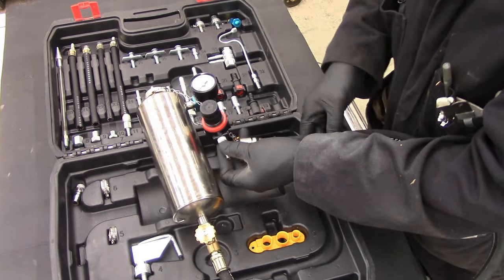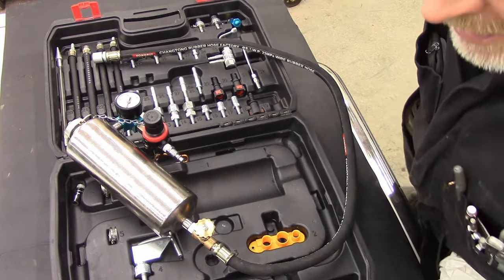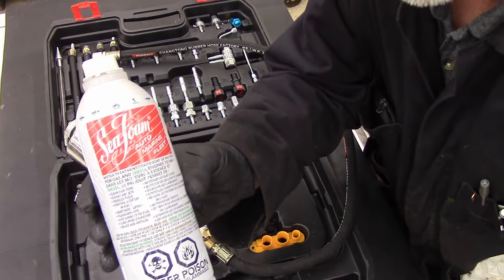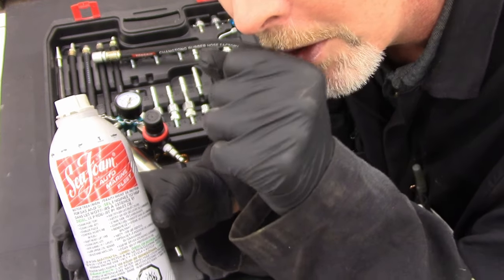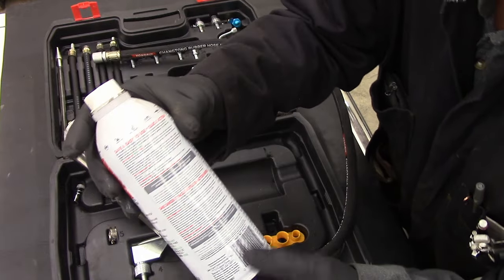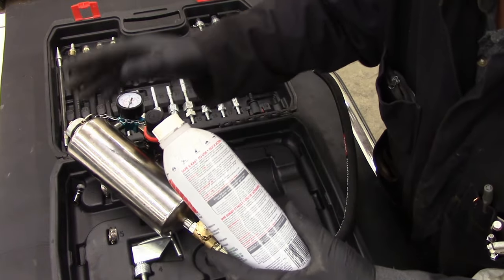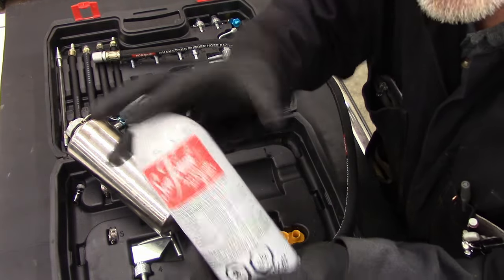This has been a bit of a challenge to find, and I tried a couple different cleaners that are looking pretty good. The only one I could find in my auto parts store that looks like it works is this. I'm not sponsored by Seafoam, but I wouldn't mind being sponsored by Seafoam. Just saying. This was the only one in my auto parts store that says in the instructions that you can use it in this type of cleaner if you mix it 50-50 with gasoline. So we're gonna try that today and see how it goes, because if that works, you can get this anywhere.